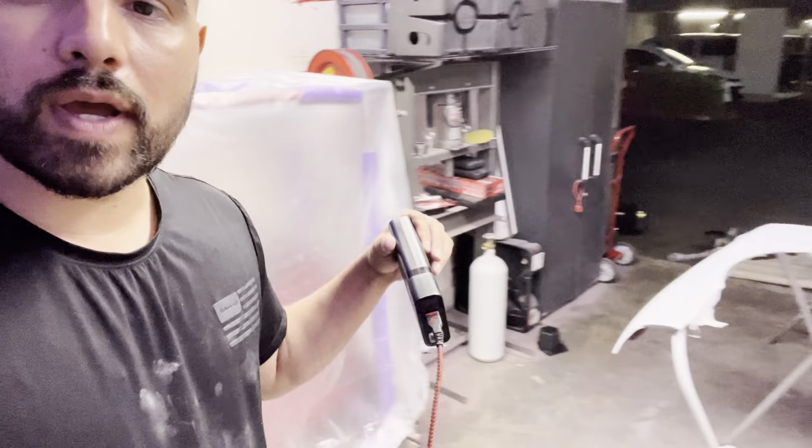It ain't happening. So this primer on the fender needs about 90 minutes to cure, and it's right at that time frame, so we're actually gonna start sanding the fender now. I know I promised I was gonna do the door in this video as well, but unfortunately I just don't have enough time. It's about 1 o'clock in the morning right now. So in this video, it's just gonna be prepping the fender. Right now I'm gonna grab some 600 and sand down this fender.